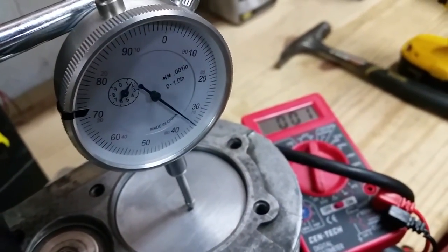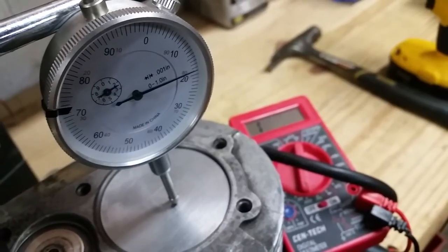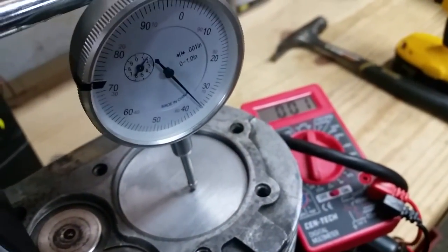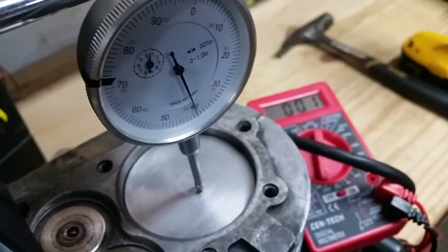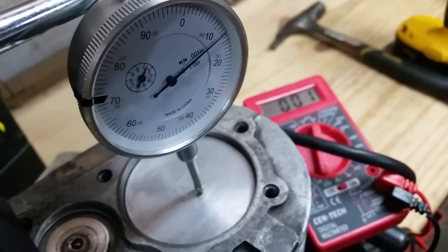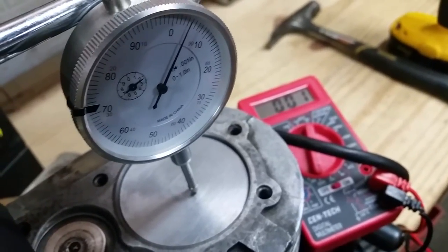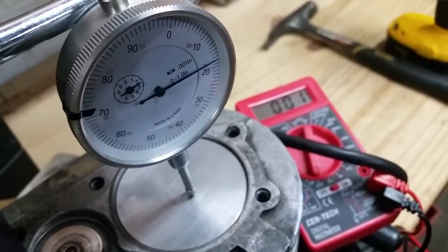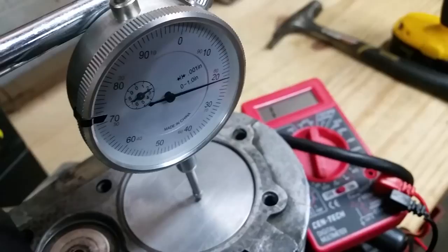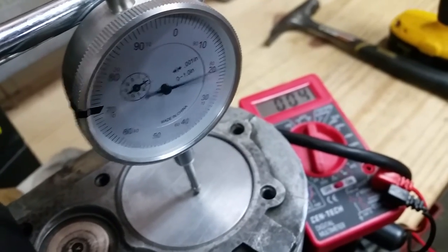Our number to hit is 0.220. You'll see that meter change right around there — right there. That is our timing dimension. Turning in the correct direction: at 200, nothing; at 210, nothing; at 215, nothing; at 220, it changes. We started at 0.300 which was top dead center, so 80 thousandths before top dead center is right there — and that's exactly what we want for the engine.